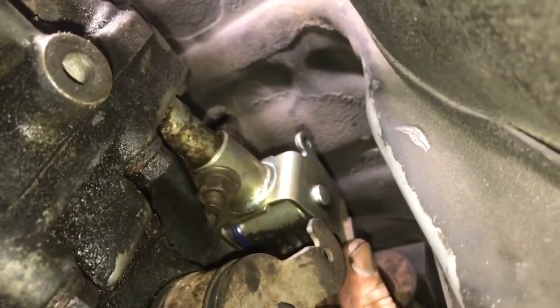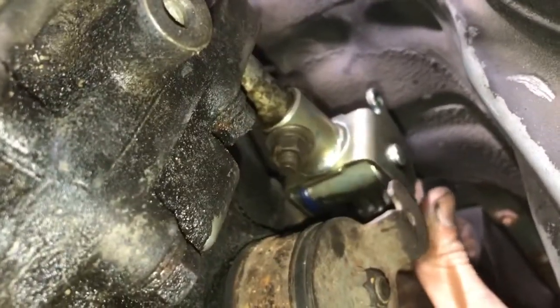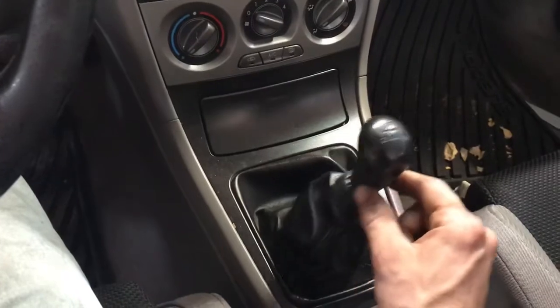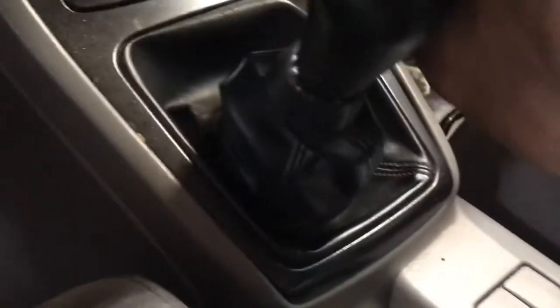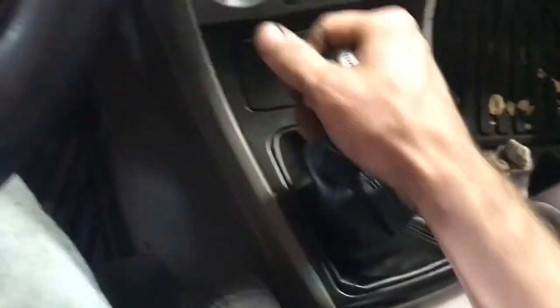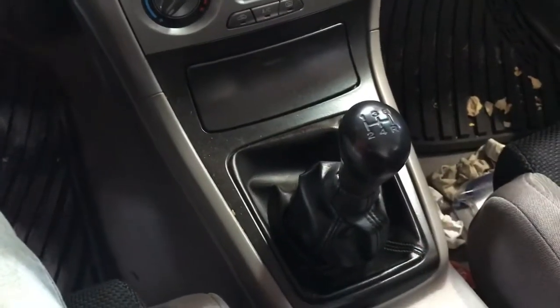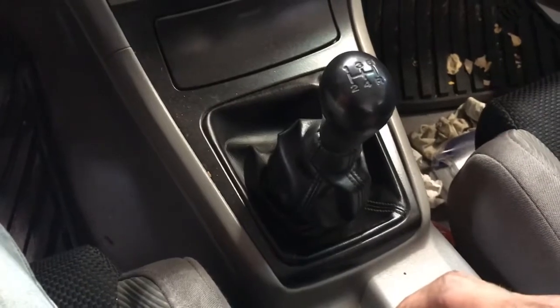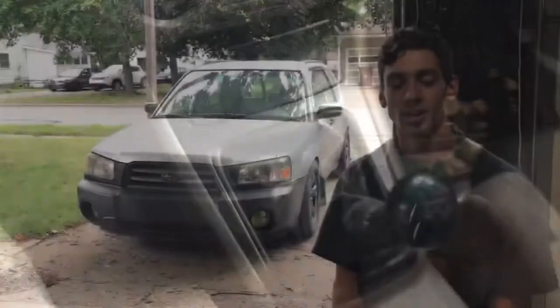There it is — there's a tiny bit of play just from the shifter input shaft, just a little slop from the age of it. There is a tiny bit, but it's in there pretty good. I feel like I could tighten that up a little more, but for now we're just gonna leave it. It still has a tiny bit of play, but nothing like it was. It's not going all the way over and smacking the edge of the little housing. It feels good — it is a little loose still, but I think a lot of that is play in the actual transmission shaft due to age. I could probably crank down or put a shim in to correct that, but otherwise I think we're good to go.